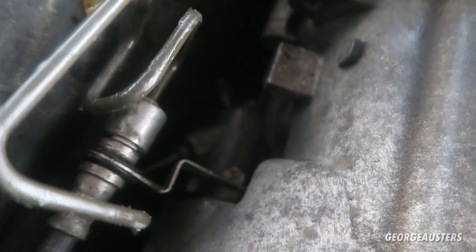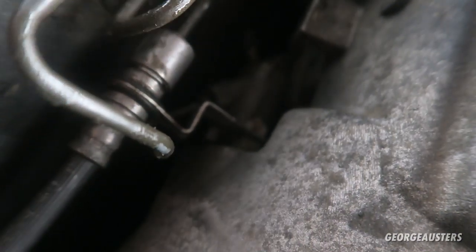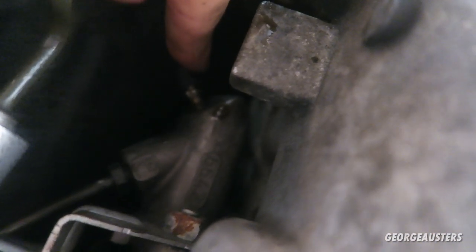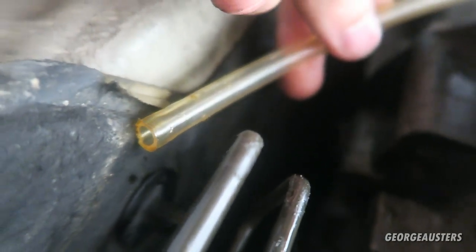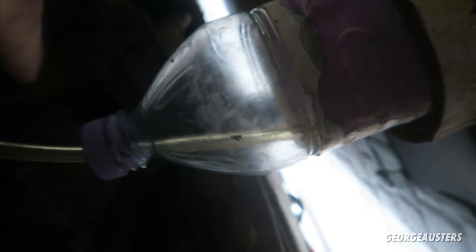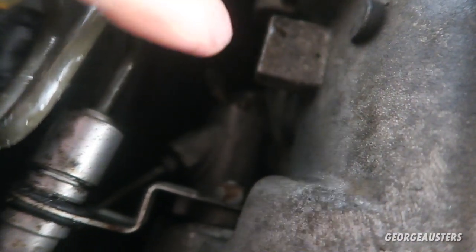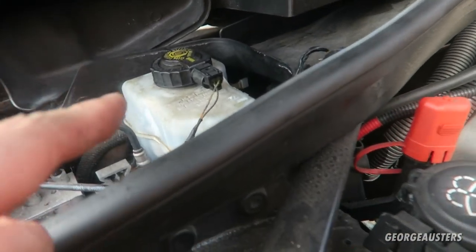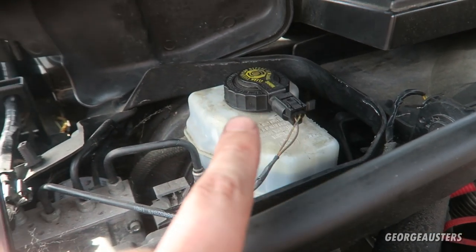Let me explain the process of bleeding the clutch fluid to get any air out of the system. If we look up here, there is a bleeder valve on the slave cylinder. On this car it is a 7mm screw - just need to undo that. I had it hooked up to a pipe going into an old bottle just to catch the old brake fluid. Essentially what I'm doing is undoing the bleeder screw and getting someone to push down on the clutch pedal, just like you would when bleeding the brake system - doing that until all the air is out of the system. We now have all of the air out, so I'm going to give this area a good clean up. It is worth noting that you need to make sure your brake fluid and clutch fluid is fully topped up.